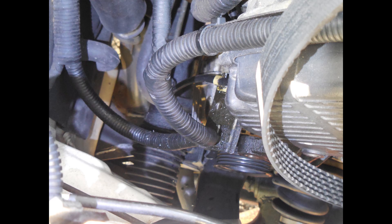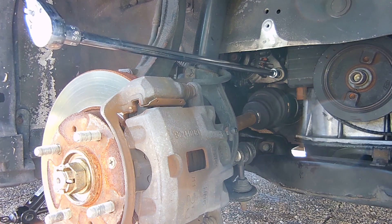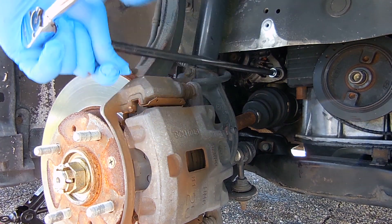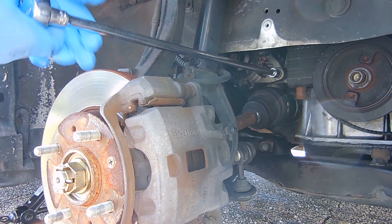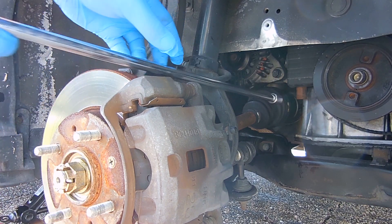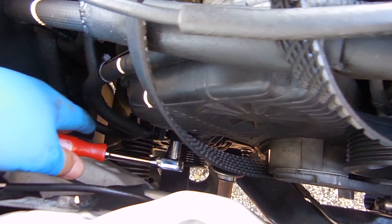In order to give you a lot more room, you're going to have to remove this metal plate. You can see there are two cables connected to it — you do not have to release the cables from the plate, but you do have to remove the one bolt holding the metal plate to the engine block. Next, loosen the larger bolt on the alternator. Normally you would reach down from the engine compartment using a ratchet, but since I have the wheel off, I'm just going to reach straight in using an extension bar. Loosen that bolt, but it's not necessary at this point to completely remove it.